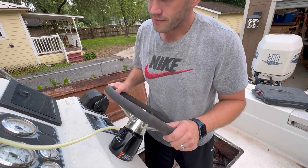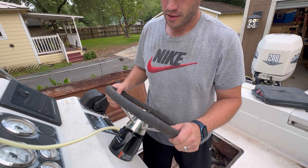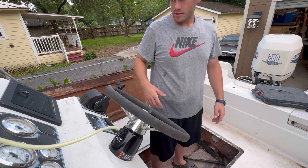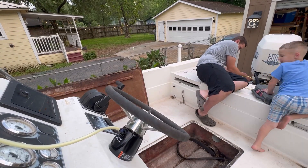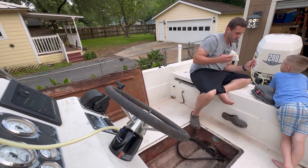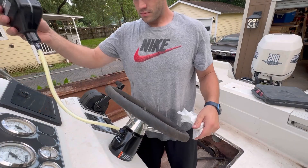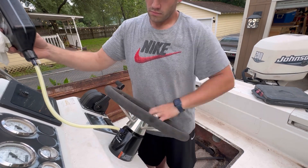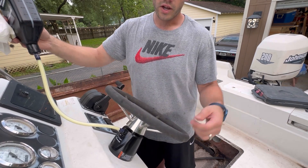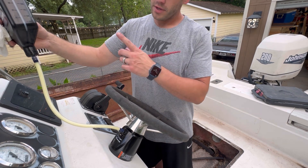I don't like the color of this stuff - it looks creamy. For now we'll see. I got another bottle here and we might change it out and flush the system. I already flushed out most of it and I'll let it calm down and see what happens, but it should be okay. The color of the fluid really does concern me a lot. If you guys have any information on this, drop me a comment below. My Google search was not very successful - I just have a feeling there's a lot of air in the system mixing with the fluid. I've unhooked my line back here, closed the bleeders off, and now I'm just recirculating again.